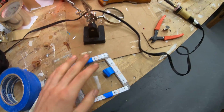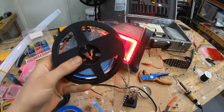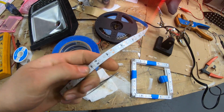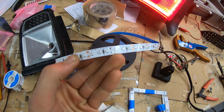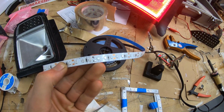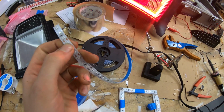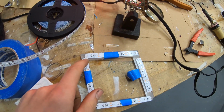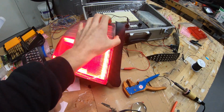So essentially I bought a strip, also from Aesthetic. I put their link in the description in the last video. I'll do it in this one too. But I got this little LED roll here, and basically there's a bunch of little LEDs on here, and they already have the resistors integrated, so they're really pretty simple. And all you do is cut and solder these little pieces here, so you can cut them at any point and solder some lines onto them so that you can continue this little strip. So that's what I did here.